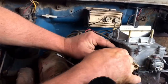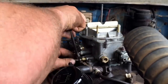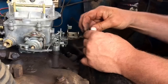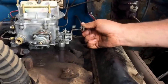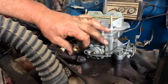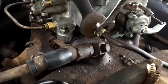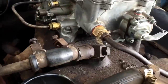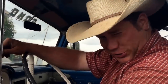I cannot tell you enough — this is a simple process. You are going to love this 2100 double-barrel carburetor. Something I didn't go over in real detail: clean out your jets with that carb cleaner. Make sure you are doing a thorough job — you want those jets cleaned out perfectly. Pop the jets out with a screwdriver — nothing has to be overly tight, you are not torquing things up. When tightening everything up, use some Teflon tape — you don't want fuel leaks or vacuum issues.